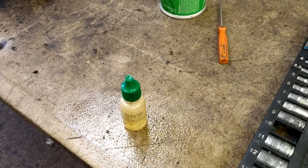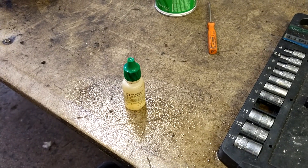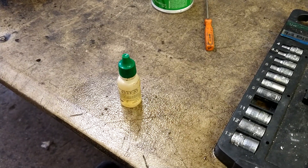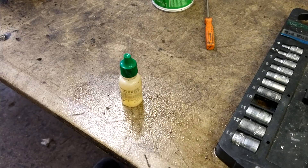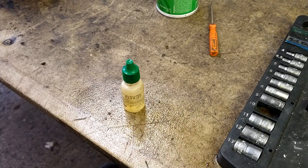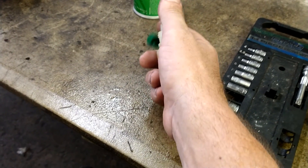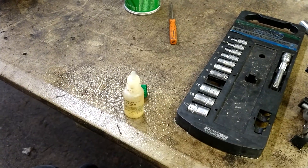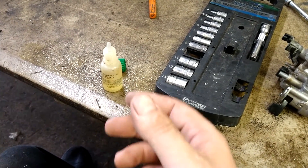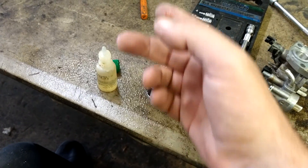This is my trick that not many people know: 14-karat gold testing solution. It is acid. Wear safety goggles, wear gloves. If you get it in your eyes, rinse with water immediately — it will blind you. If you get it on your skin, rinse with water immediately — it will burn. I've gotten this in my eyes and rinsed it out with no damage, but be very careful. I've tried all other acids and making my own — don't use anything but the green-top 14-karat gold testing solution. I'll put the link in the description. Don't use any other acids — they melt through the jets and the aluminum, or they don't do anything at all. I've ruined many a carburetor figuring out the best stuff, and this is it.